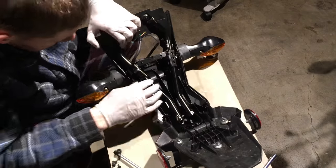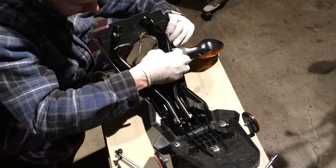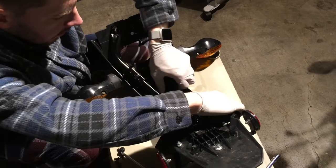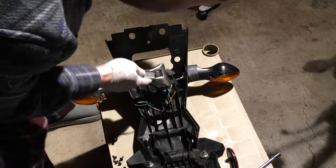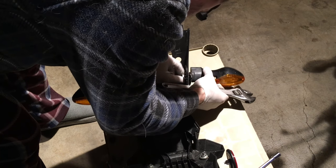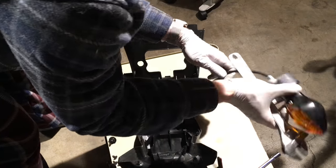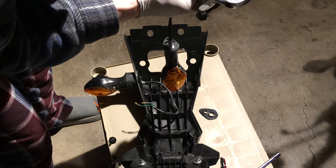There's the metal subframe — it's kind of tricky. Once you get it to pop, the trick is to bend the plastic on both sides until the risers pop out of the metal and it liberates. I used a crescent wrench, but a 14mm box wrench would be a lot better. Make sure you save the washer and the flanged 14mm nut — you're going to need those to reinstall the turn signals onto the fender eliminator kit.